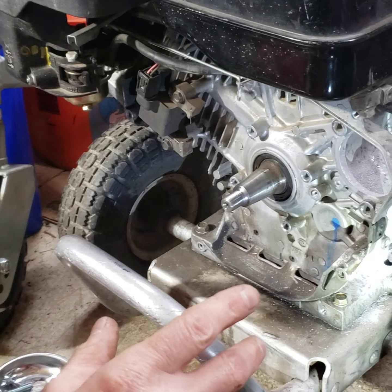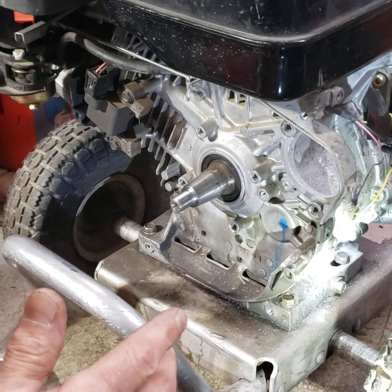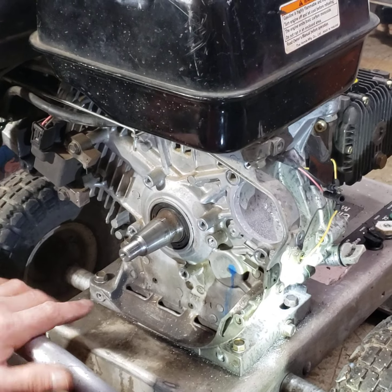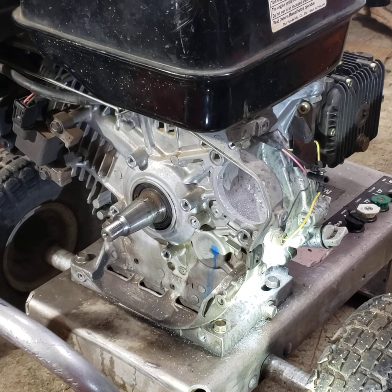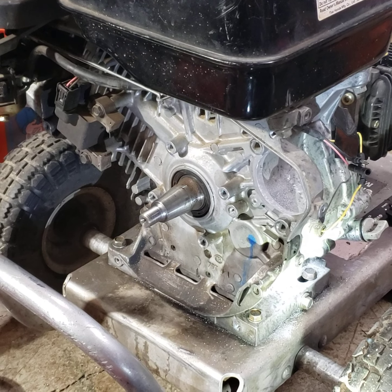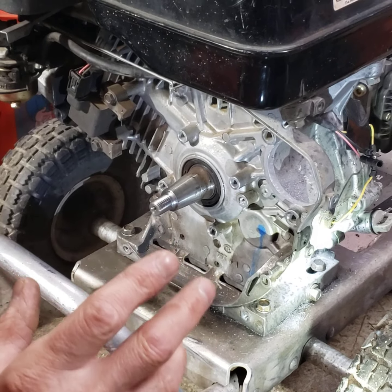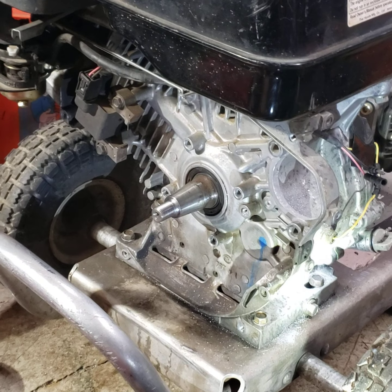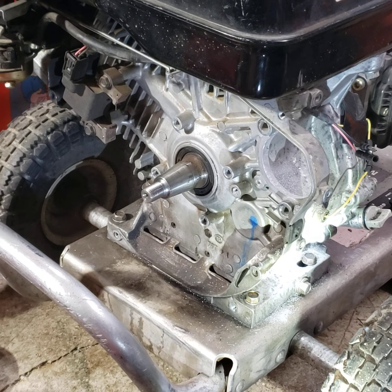For the rest of the wiring, go to eBay and look for the Honda GX390. These kits are only supposed to be made for 2010 or older motors. This is a 2011, which is why the timing is going to be off — Honda changed the keyways on their cranks on the 2011. Anyway, this is how you get it to run. If you find a listing, they'll show you the wiring diagram and you can follow that or look it up online. Hopefully that helps some people out.